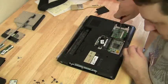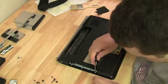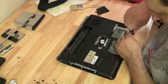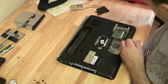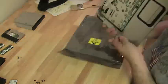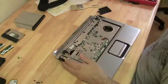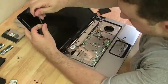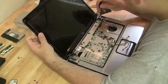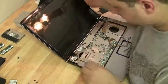Make sure you reattach all the cables — all the ribbon cables. Get those standoffs back on and reattach all the screws. Attach the screen, and while holding it gently, put all the screws back in and tighten them up with a higher torque screwdriver, because you don't want the screws that hold the monitor on to get loose.